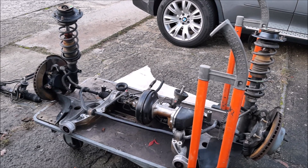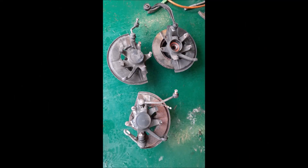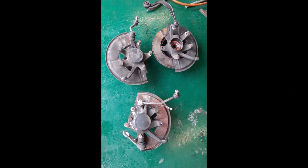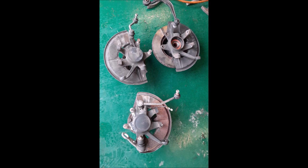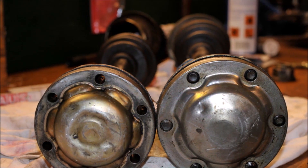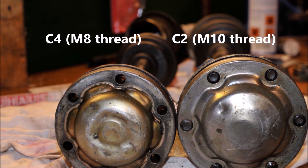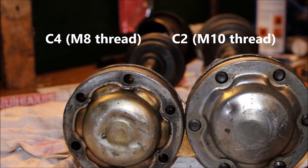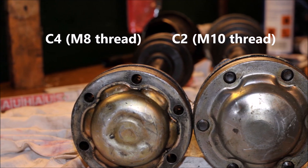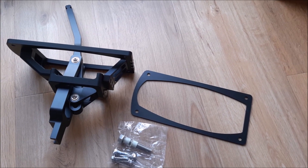You also need to address the front axle — at least the outer joints of the Carrera 4 drive shafts, which are fortunately available as spare parts. On the rear axle you need the drive shafts of the Carrera 2, because the screws have M10 instead of M8 thread and the bolt circle of the flange is different.